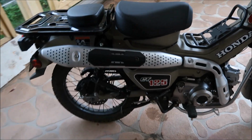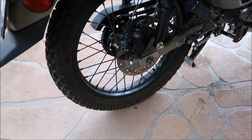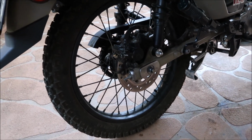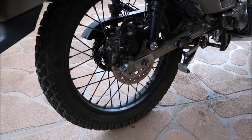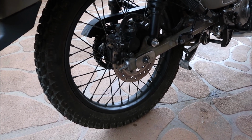But the only problem is up around, once again, 75, I've now got the rear end shake from this tyre, which has got 8 ounces of slime in it too. So I think the idea, if you're going to put slime in one of these tube tyres, is to forget about what they recommend at 8 ounces and probably try 4. That may be the way to go.